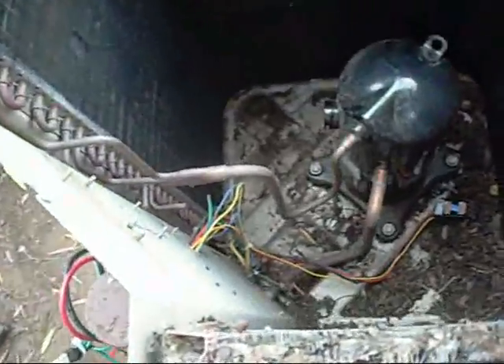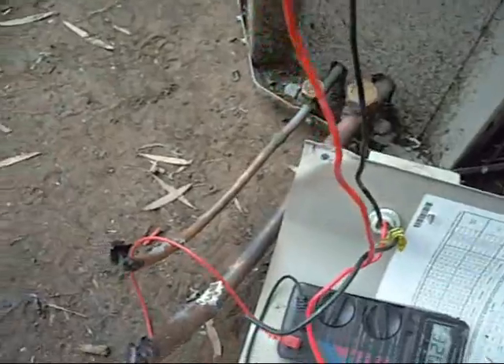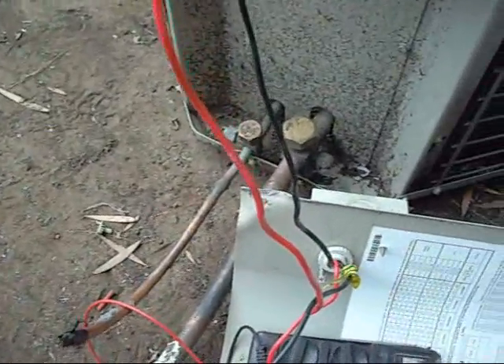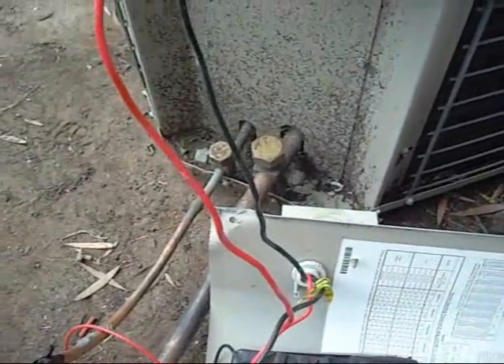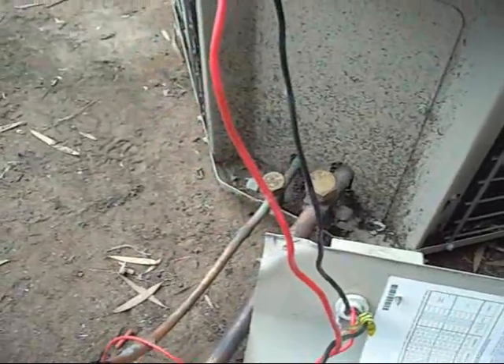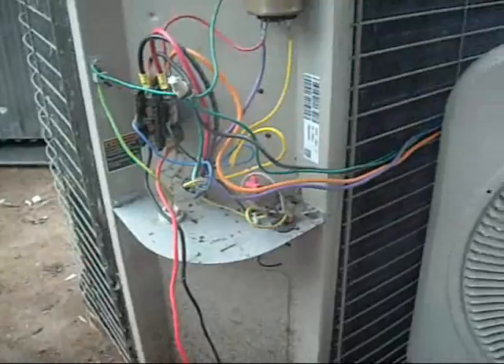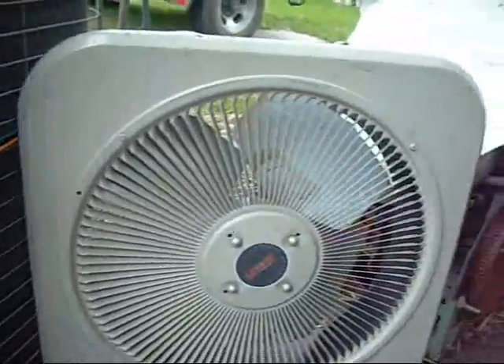But no, it looks like a well-made unit. I hope it doesn't have a leak, and that's where a bit of testing will come into it. Since it doesn't have any measurable amount of refrigerant in it, I might as well seal these pipes up with some solder, open the valves, evacuate it first, then pump nitrogen into it and just do a leak-down test to see if it leaks. Because if it does, then we've got a problem. It's funny that it didn't have any refrigerant in it - usually when I find one without gas it's because it's been damaged or leaked.